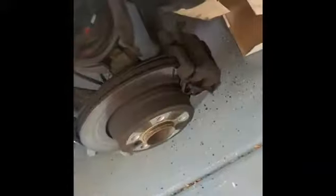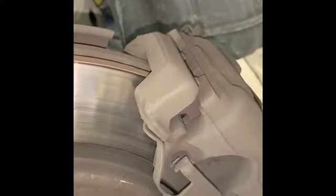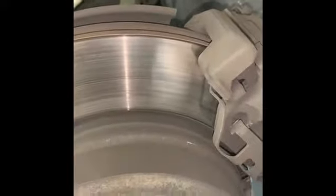Something I didn't get a chance to talk about earlier is these retaining clips that help pull the caliper in place. So this is it here — I've already knocked this one out. They're set up exactly the same way in the front. This one's still in — you can see that it's still in, and I popped this one out. See that lip right there? It goes into a little hole or ridge on the inside of that. To get it out, you want to get underneath here with a screwdriver to pry and push up so that that lip will clear the ridge, and then you can back it out. Just like that. Probably wear safety glasses.